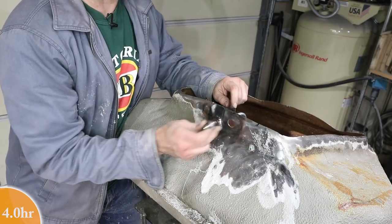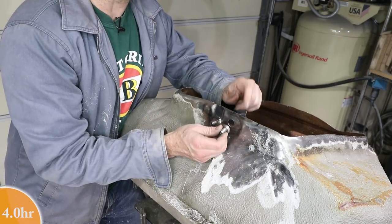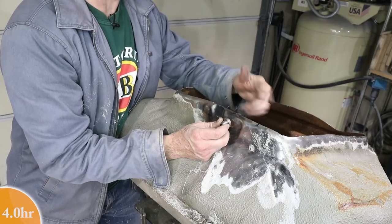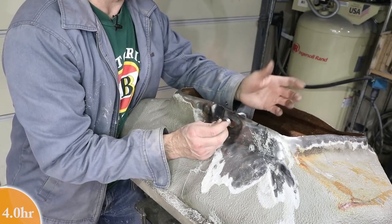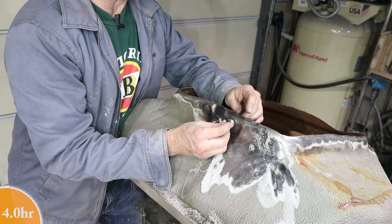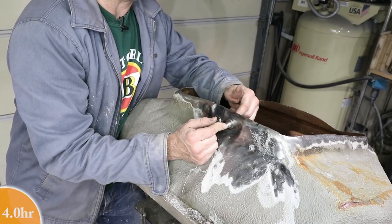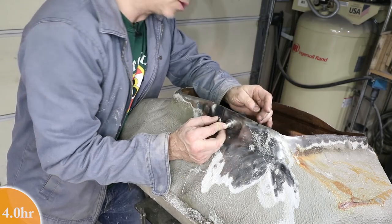And it's gonna have the same fitting in the stock location, but I determined I'm not gonna do anything special on the inside of the tank. I considered using the stock system to recirculate the fuel back into the fuel tank, but I think it's okay given that I'm using this baffle box. I don't see any way that any disturbance or bubbles are gonna get into the baffle box. If I just return the fuel right down here low in the tank, it shouldn't create any sort of foaming or bubbles or anything. So that's what I'm gonna do.